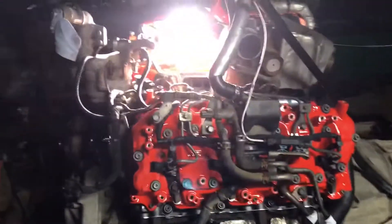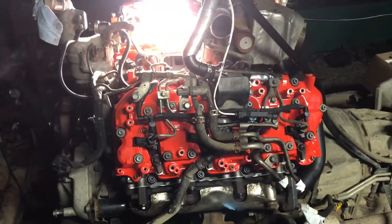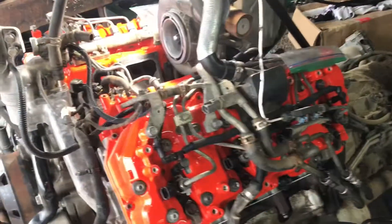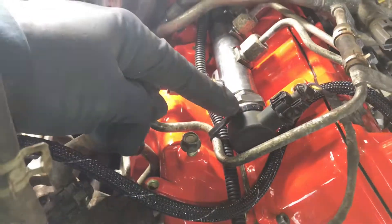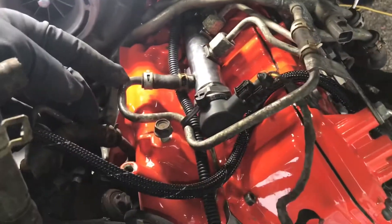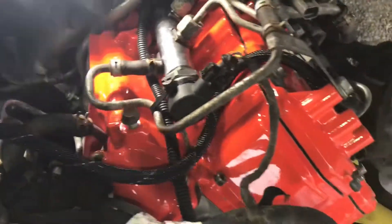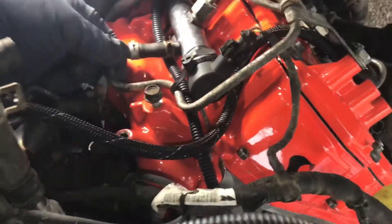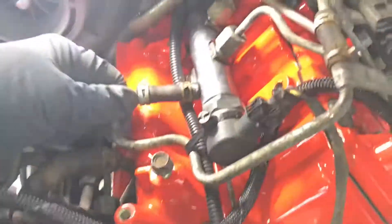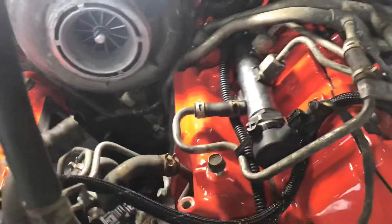Then it's ready for the Y bridge and wiring harness. It's dark at 11 o'clock. All the fuel lines are tied in, run up and over, everything's back to basically stock on the filter side. I put a zip tie here — there's a hold down but I've seen guys on newer trucks where putting a lift pump on it will blow this fitting off. Their fix was to zip tie it. This one has a hold down and an elbow shape but had quite a bit of movement, so a zip tie adds a little security to keep that from popping apart.